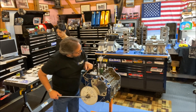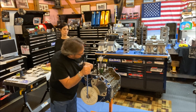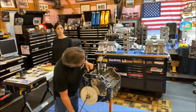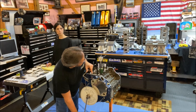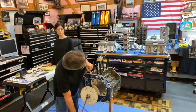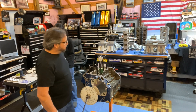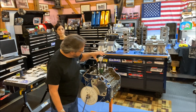Looking at this right now, I'm going to say it's 31.5 — that's the intake valve opening. It's supposed to be 30.5, so it's advanced a little bit. Next we go to max cam lift. According to the cam sheet it was 430 thousandths — let's see where we're at. Going up: 50, 100, 200, 300, and now we're coming up to max lobe lift. We're going to call that 427 thousandths. Max lift is 427 — it's supposed to be 430, it's a reground cam, lots of variables, it won't make much difference.